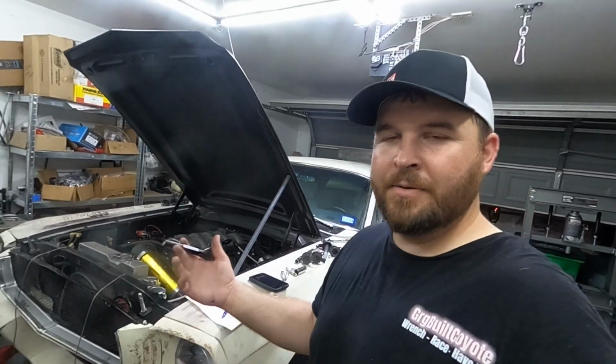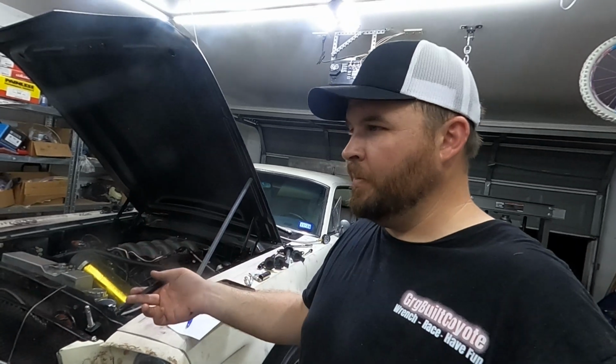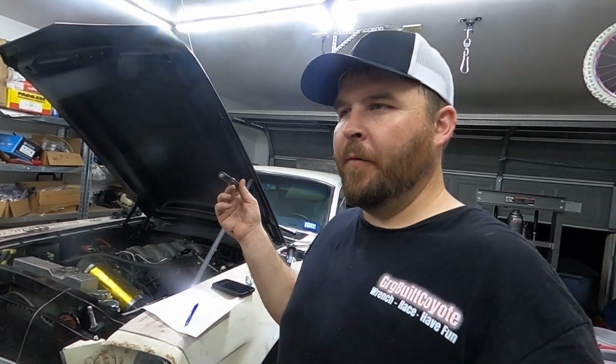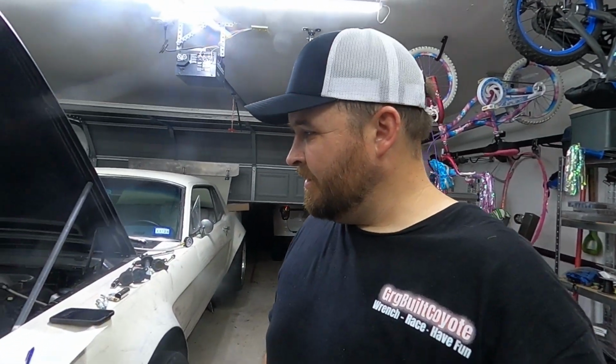Yeah, because the compression test is good. There's no knock activity, no signs of issues with the engine or fueling or lubrication. It's the transmission leaking fluid onto the clutch. The face of the throwout bearing was all wet. I didn't see any on the pressure plate, but if it's able to leak from the front plate all the way down the bell housing to the little window, I'm sure it's getting slung up somehow. And does that mean a new clutch? So possibly a new clutch, because wouldn't that be considered contaminating the clutch material?